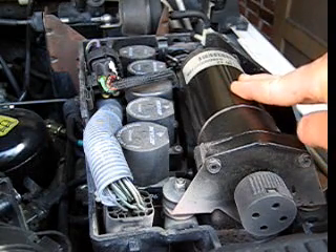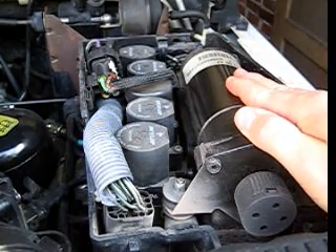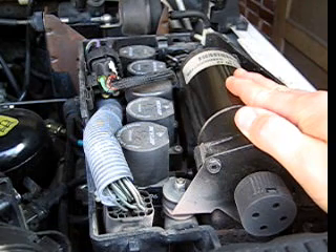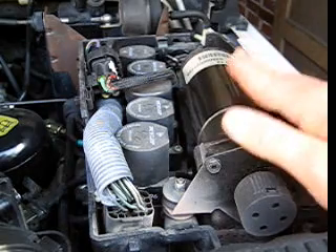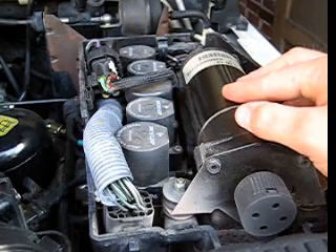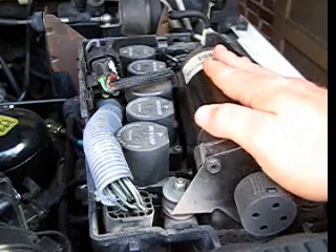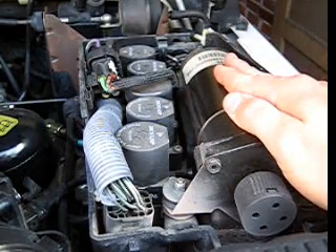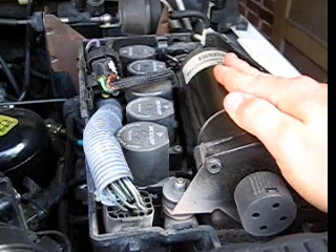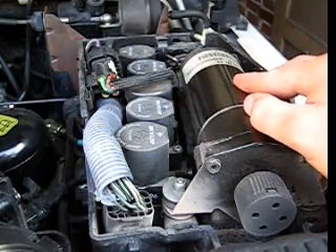This is a situation where the compressor is actually working properly — it can be triggered manually. Using the EAS unlock software, you can trigger the compressor and it runs properly. But during normal operation, the compressor is simply refusing to run. In this video I'm going to show you how to test the over-temp sensor and the pressure sensor. If either of those two sensors are faulty, the EAS computer will see no reason to run the compressor and it will stay dormant under normal operation.